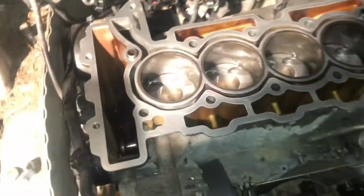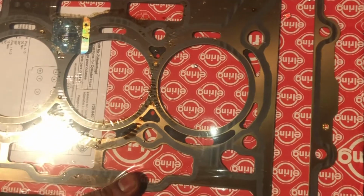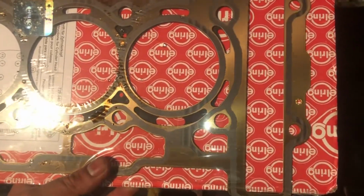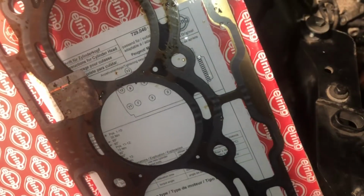So next, I'm going to put the head gasket on. Straight on. Obviously make sure, well, you would have done this already, because I would have measured up the old gasket, what was left of it, with this one. It looks like in this as well, you've actually got the tightening sequence in there as well. So I'll double check that in there.